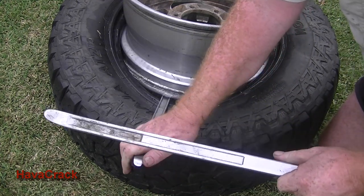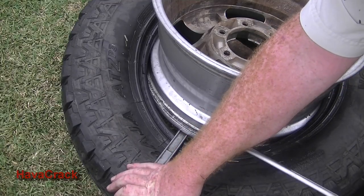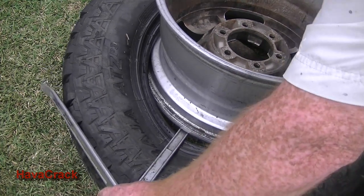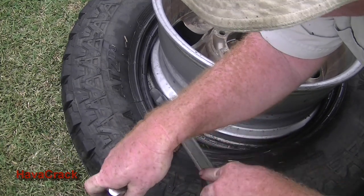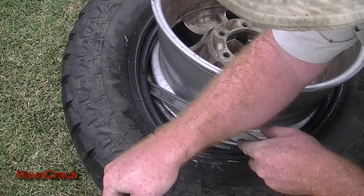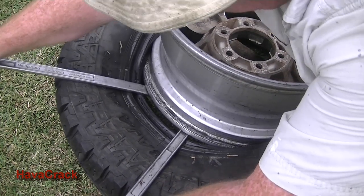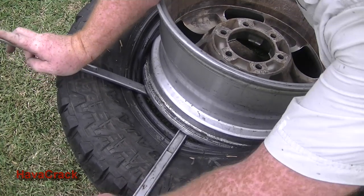But I'll bring the camera in a bit closer again. So I'm now working around the camera. As I say, we've still got our first pinch on. Okay, so I need to hold that. Stumble a bit. So with our tyre plier, we stick our second one underneath, then we pull it up, and then we lift it. Okay, so we got that one.